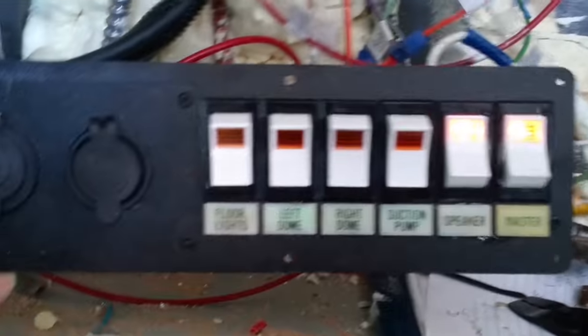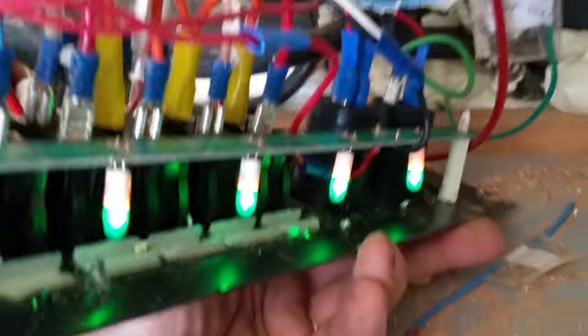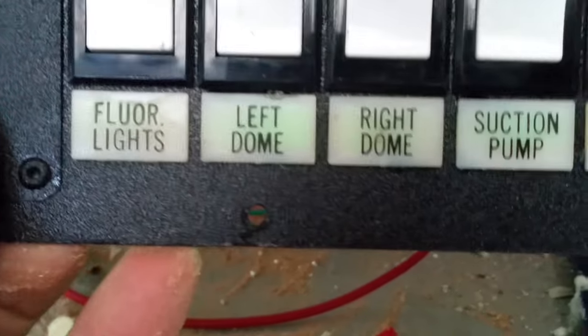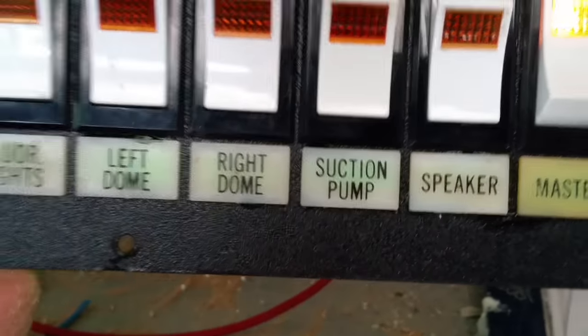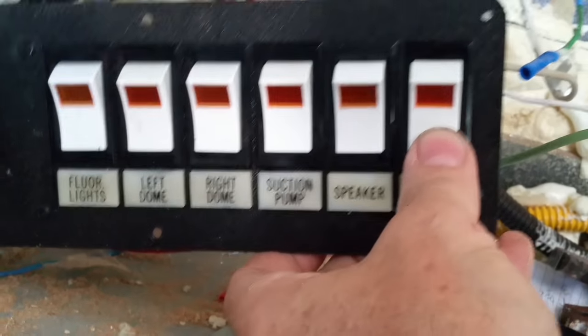Back to getting the control panel - the back panel behind the stove, coffee pot, and where the vent hood is going to go. Something that really takes forever but is cool is the customization. I was actually able to use part of the ambulance control panel because it has LED lighting. I was able to cut that panel down to size, literally break the LED panel and re-screw it down to a shortened panel, so at night it'll illuminate the switch labels. The master switch just controls the LED lights themselves - turns those off in case you're bothered by them trying to sleep.